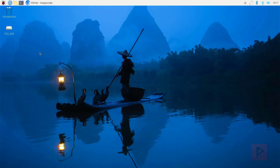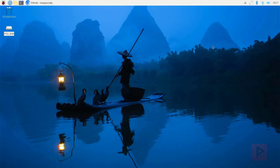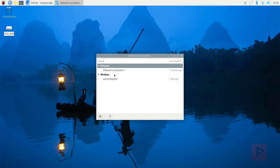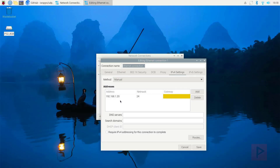So the first thing is, I have my thumb drive connected. Here it is — I have my games in the DVD folder, so that's nothing special there. And just in case, I did set up a static IP address for my Raspberry Pi 5. The easiest method is you can go to advanced options, go to edit connections, and add your ethernet connection. Here's my ethernet connection — it's wired to my PS2. In the IPv4 settings, when you go through the wizard, the address I have set up is 192.168.1.20.